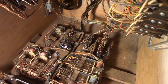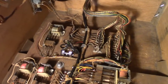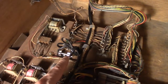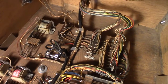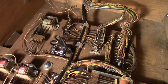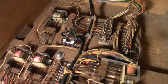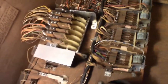Here we are inside the motor board area — I have the playfield above me so I have to watch my clearance. I had mentioned last time that I was going to redo the power with new wire coming in, and I did do that. I installed a new fuse block going with the main wiring — it's a 5-amp slow-blow — and I ran the wire down to the new on/off switch.